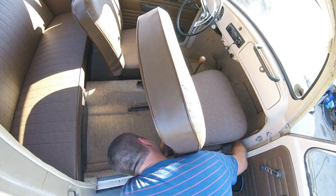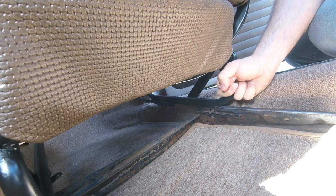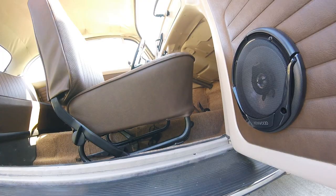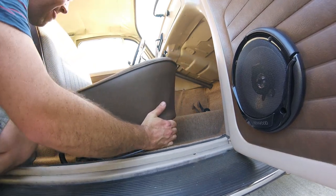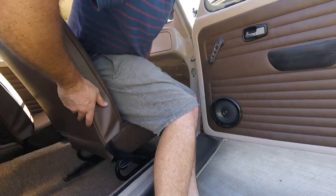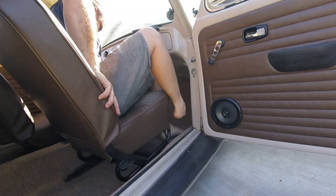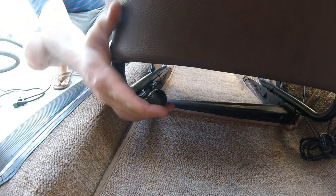The next step is to line up your seat onto the seat rails. This can be a little tricky because the seat frames can warp in and out, so don't be scared to give them a little tug and bend here and there to make sure they sit up on the seat rails correctly, sliding across the rails with minimal force. Once you have the seat slid on a few inches, adjust your stance and start pulling and pushing with your arms, getting the seat further down the rails. Once you can't shove it on anymore with your arms, sit on the seat and do a squat motion to push it with your legs. All the while, hold the little lever while pushing and pulling the seat onto its seat rails.